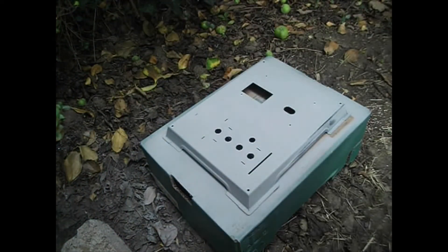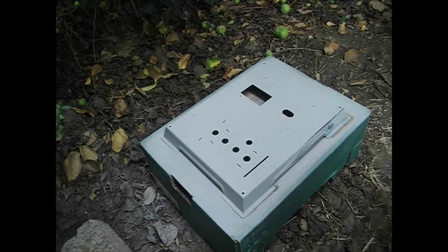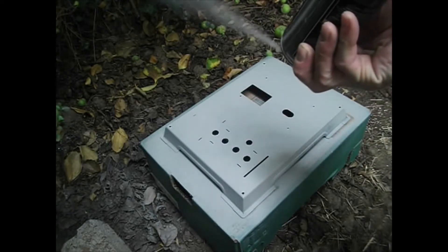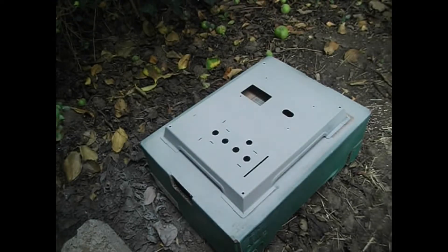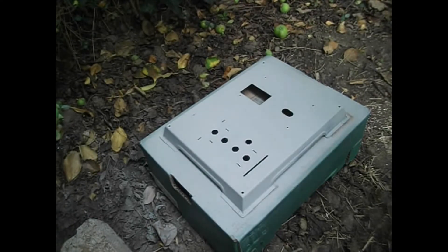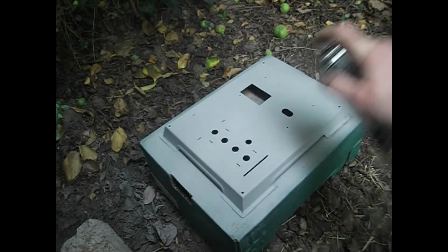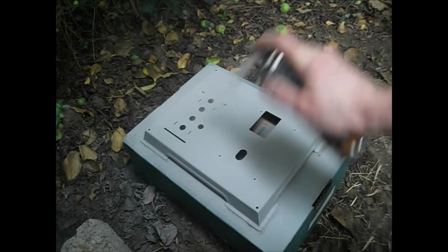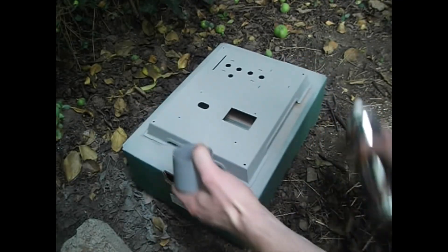Okay, perfect. Let's give that another little tickle with the primer and we'll see how that looks when the next layer is dry. Remember I've gone right the way back to metal, so it's going to take two, maybe three coats before this is ready. Take your time, be patient. Always clean the nozzle. On with a slightly thicker coat this time.